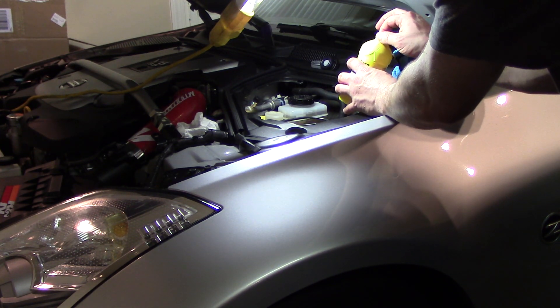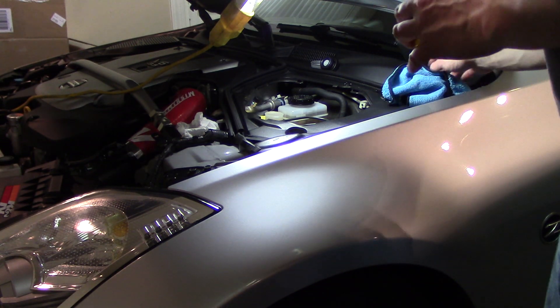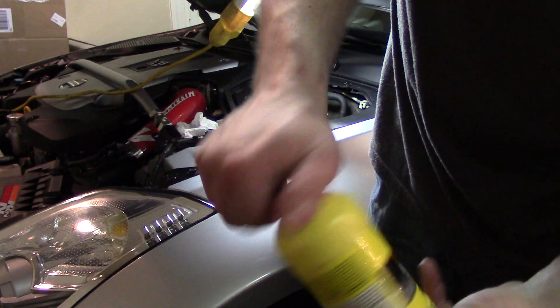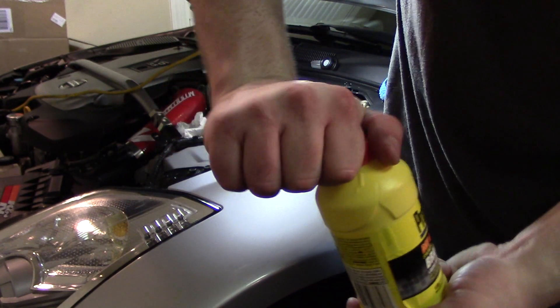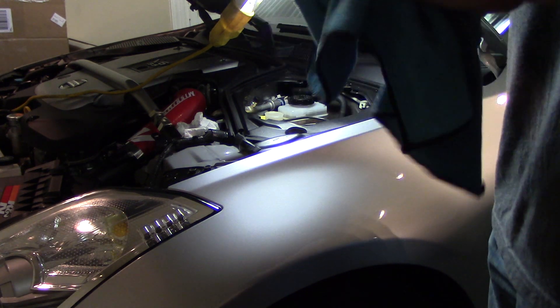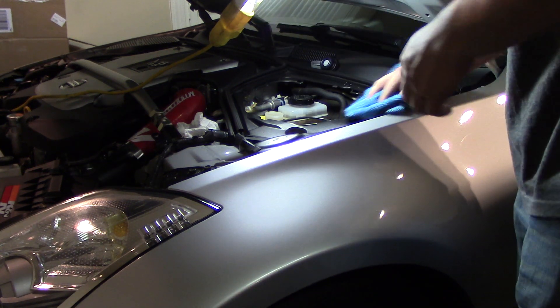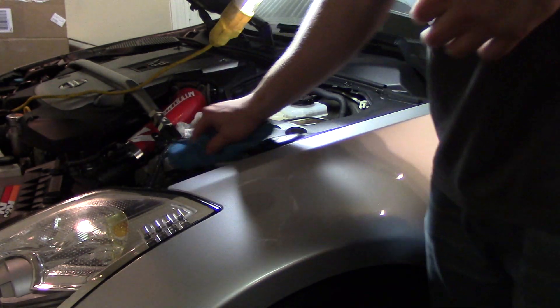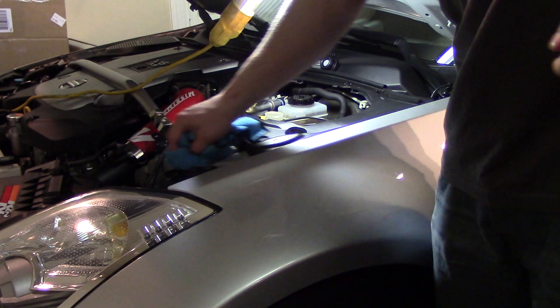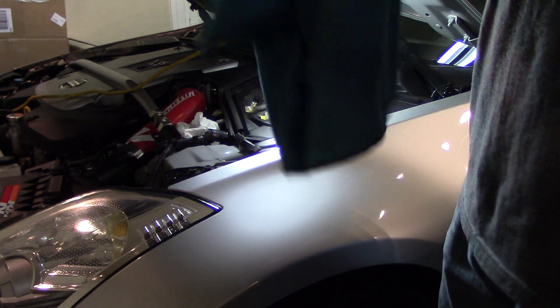My car is relatively warm so I'm putting it about halfway between the lines, a little higher than that. I'll get the camera close to show you the level. I'm going to leave the cap off for now. If you plan on keeping the brake fluid bottle, close it very tight for a good seal. I personally wouldn't keep brake fluid more than a year - it's not expensive, just a few dollars a bottle, so buy fresh if it's been more than six months.